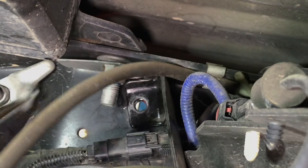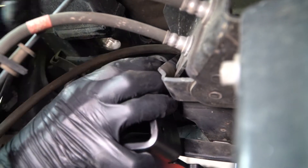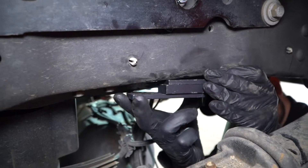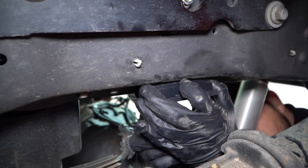Go ahead and remove the bolt and clip. The upper bracket aligns with the urea tank bracket and, if necessary, has several spacers to use — whichever combination is right for your truck. Just be sure that before fastening, there are no wires or hoses that will get pinched between the bracket and frame.